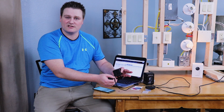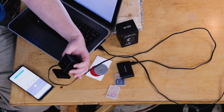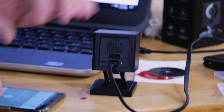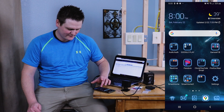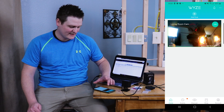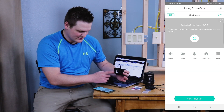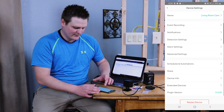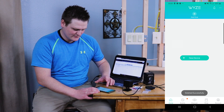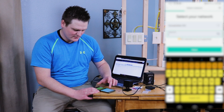Pull the power to reset it. You should see a solid orange light, then it'll go through its boot-up and connect to the phone. Close and reopen the Wyze app — it'll show the camera as offline. Hit the setup button, delete the old device, and add a new device. I'm not going to walk through this step by step since we've already covered it — just make sure all your settings are correct.